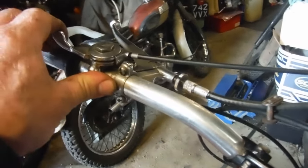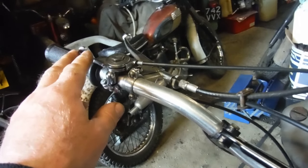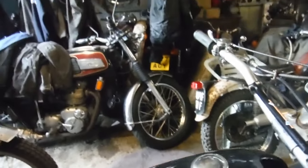And I think, I'm not sure, but I think it might be tight wire advance on this magneto control, because the spark appeared to be stronger when the lever was pulled back. So that's how I'll have it when I try and start it. So, take two. See if we get anything this time.